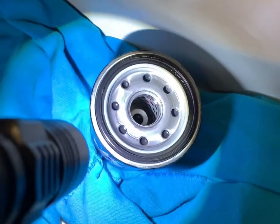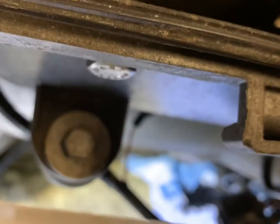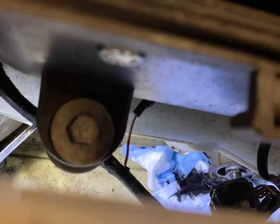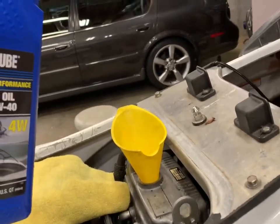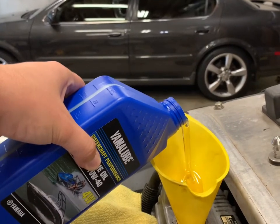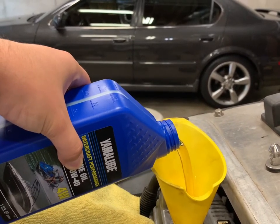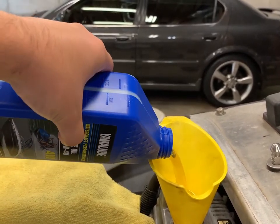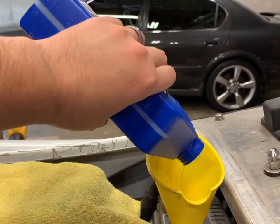I put a little bit of oil in the filter and placed a rag under where the oil filter sits so when I pulled it out it didn't make a mess. Now I'm putting the new oil filter on. Since I only took out a quart and a half, I'm going to put in two quarts because it was on the low mark. When you're done, run the ski and double-check the level — you need to run it on the lake for the most accurate reading because on the hose it doesn't heat up enough.